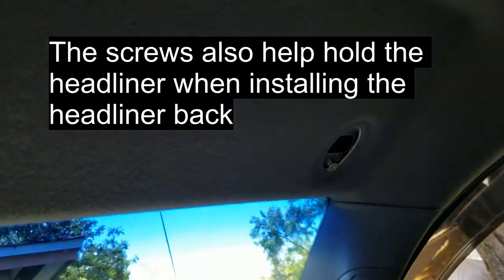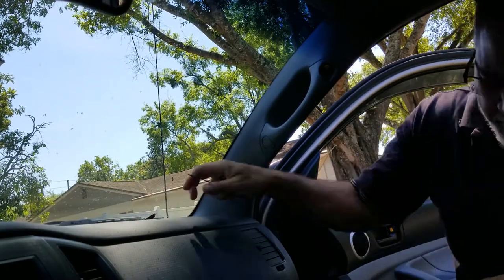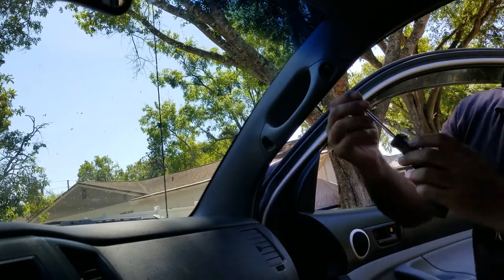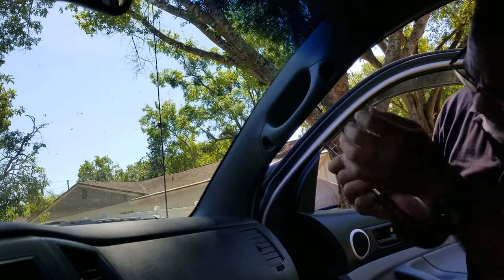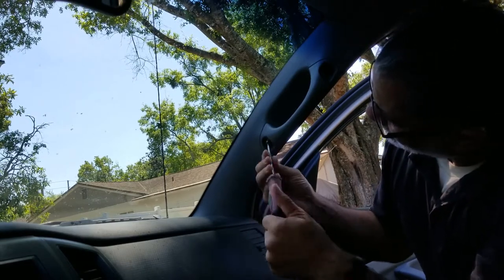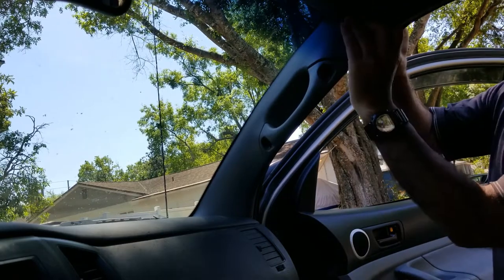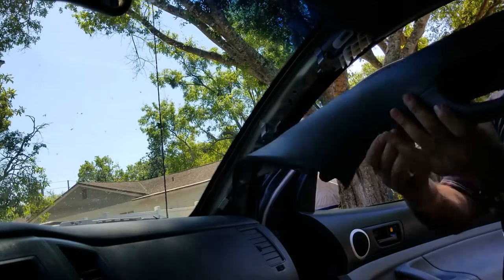Since I really don't want to lose or misplace the screws, I'm just going to put them back where they were. There's one and there's the other one. Use a thin screwdriver to remove this little cap. Same thing on the other one. Now you have two Phillips screws. Now this is just loose — some clips — and the bottom. Slide it up because it slides into the dash over here.